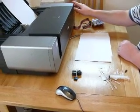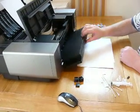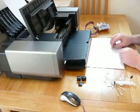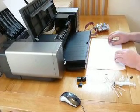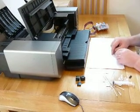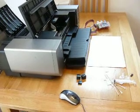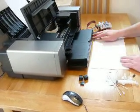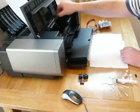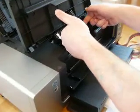The first thing I'm going to do is switch the printer on and open the lid. This will cause the carriage block to move into the middle position and we're then going to remove the print head. To remove the print head, lift the grey lever upwards and tilt the print head towards you and then just slowly move it out like that.